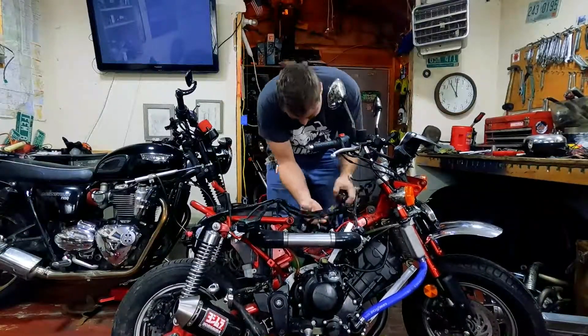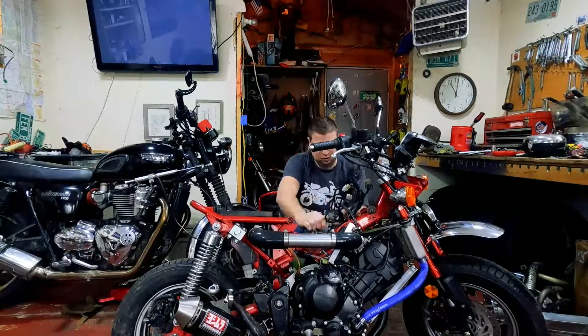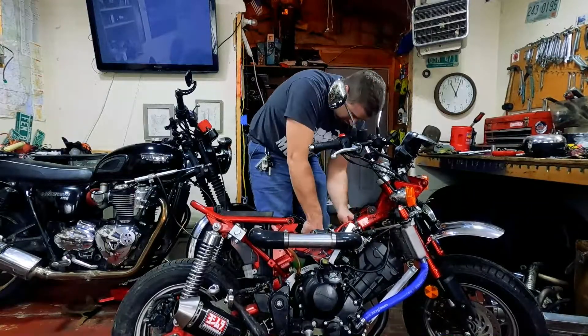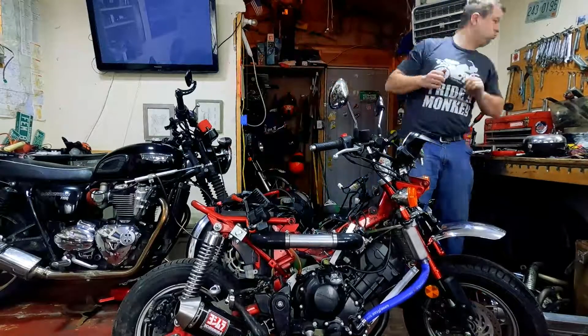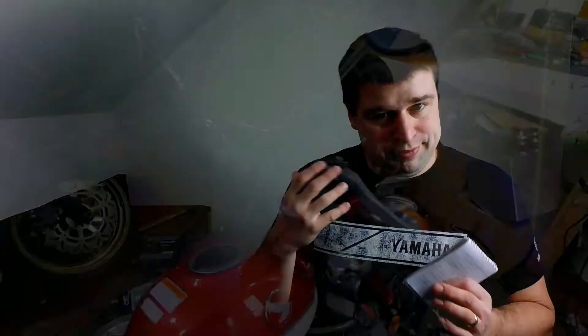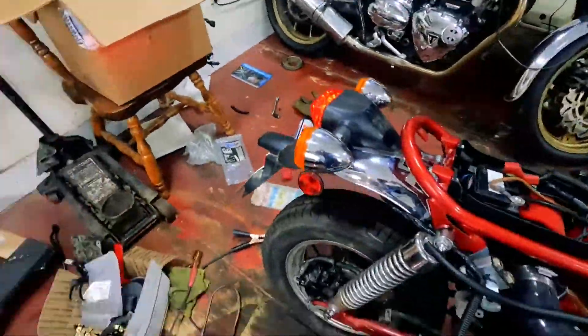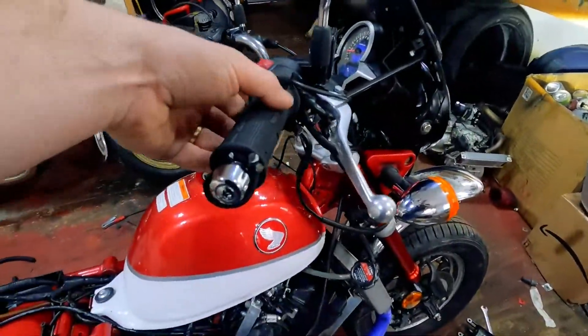The first thing was just running the wires, making sure everything is correct, running your harness. I basically took the harness off the 250 and ran it with the diagram. I had the tail section of the monkey with me in the house because it was just too cold outside to work on it. I ran all the wires so that the left directional was wired up correctly. For the right directional, I deleted that so I could use the directional feed into the sidecar, since I'm running directional lights on the sidecar.